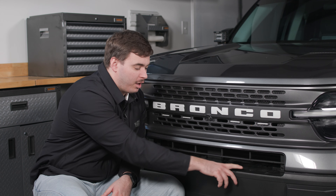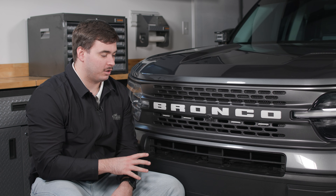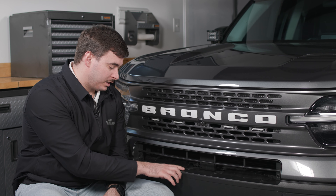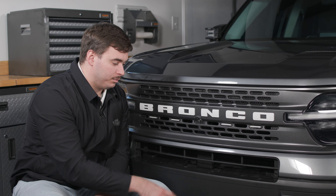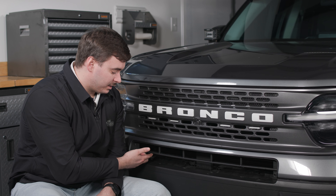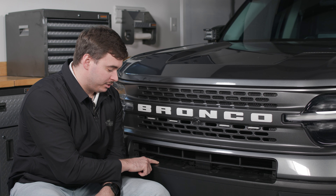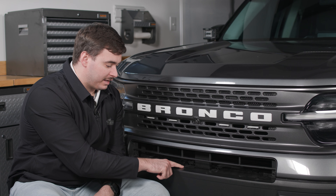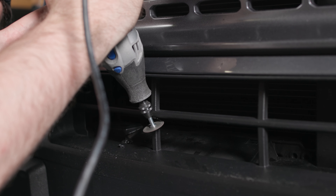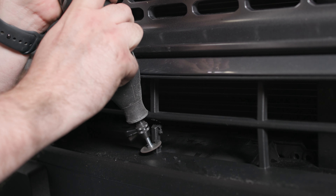The first thing we need to do for this install is remove these four plastic beams on the bottom of the lower intake area. We've gone ahead and done that for our preliminary install to test fit this bar, but we'll throw some clips up on the screen of us removing this. You'll just want to take a dremel, or you could even use a handsaw. Just make a nice clean cut, and we went back and sanded down the little excess parts as well.